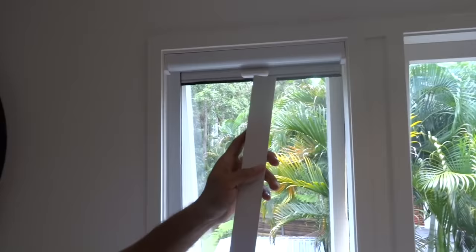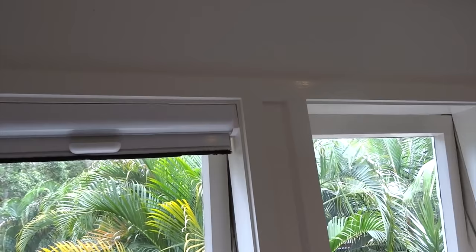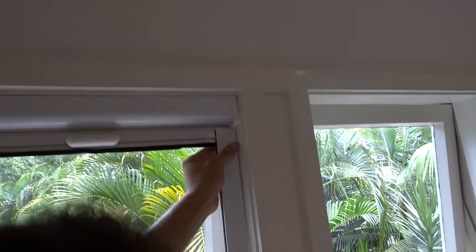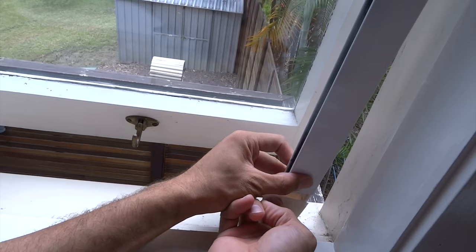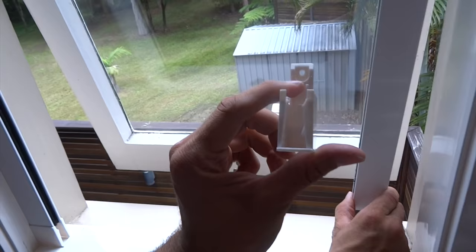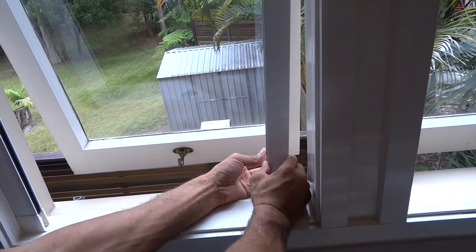The next step is to put the side tracks on. I've already done this one here, so I'll just show you how it goes with this one. Same deal with the side track — this little locating strip here goes onto the lug that's located there, so you must make sure that goes on. An easy step: take the plastic cap off the bottom, gives you a bit of room to move it. Slide it up, and this bit has to go inside the cassette. Once it's sitting inside, that's perfect. Then put this cap back on by simply sliding it out to the side — the plastic lug slides in the same slot. Also, the little clip on there — that's what hooks the handle shut. This bit here must be facing the front, and able for your window to close and lock down.